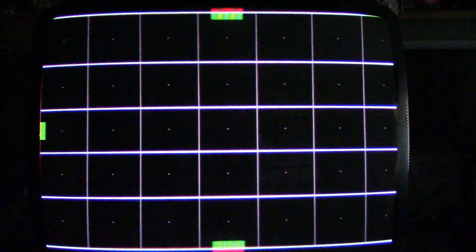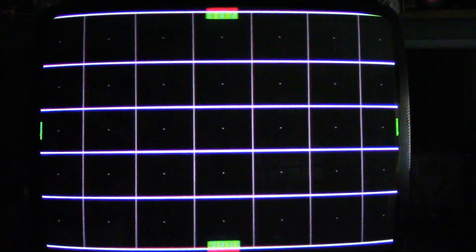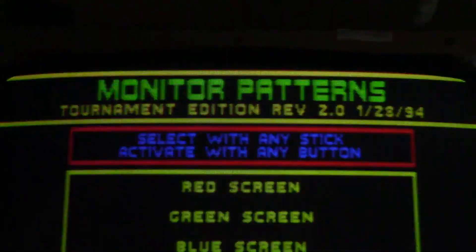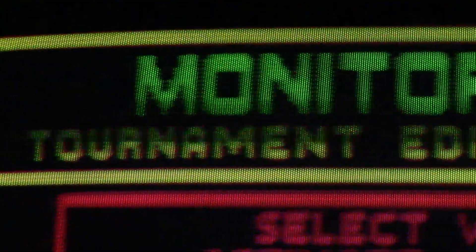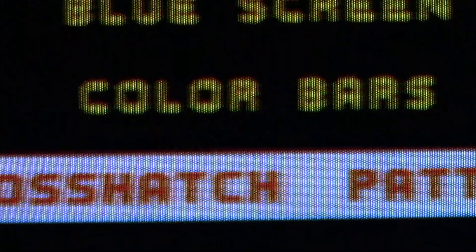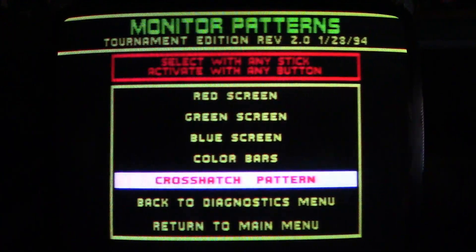Let's turn our light off. I'd say that's good enough for government work. Let's move our H position over slightly — roughly there. Yeah, I'm happy with that. If we go up here and look compared to how it used to be — that's good, darn near perfect. We've still got some in the corner, not worth messing with, but on the main area that's good. We're still kind of blurry a bit but this tube was always a bit blurry. Let's zoom in to see if we can make it a bit better — I think it's already set to the best it can be.